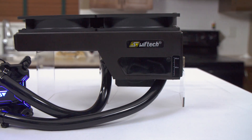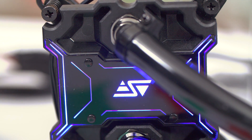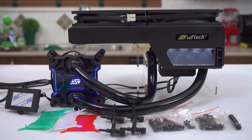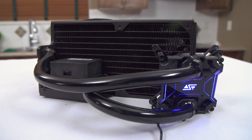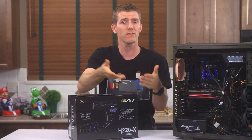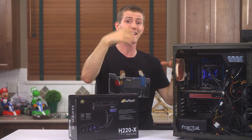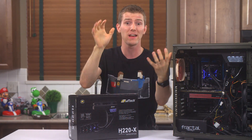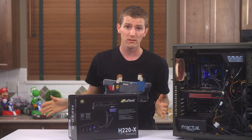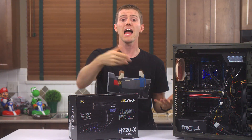Some of these things are probably a little overkill and aren't needed with competing all-in-one liquid cooler designs because of how tightly integrated they are. But the point here is not the base functionality, but rather the fact that you're getting expandability and truly enthusiast class water cooling gear in an AIO. Most all-in-one water coolers are sealed because they need to be — the pumps wouldn't work with more components in the loop, or a larger radiator, or the tubing is permanently attached to plastic barbs to save the cost of fittings and clamps. Not the case here. You can install it out of the box more easily than most air coolers, or you can tear it apart and add more blocks, radiators, and what have you, because the components — particularly the pump — have performance to spare.